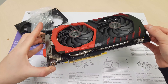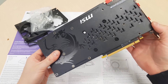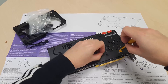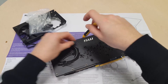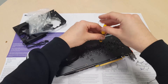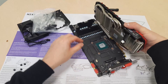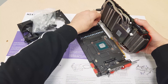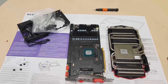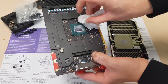It is designed to allow you to attach any standard all-in-one CPU water cooling solution. For my system, I decided to use the Corsair H90 Hydro Series liquid cooler because it has a large 140mm radiator. It is listed on the Kraken G12 compatibility list and it was the best option in my local store. Please keep in mind that you may void the warranty of your video card when removing the stock cooling.